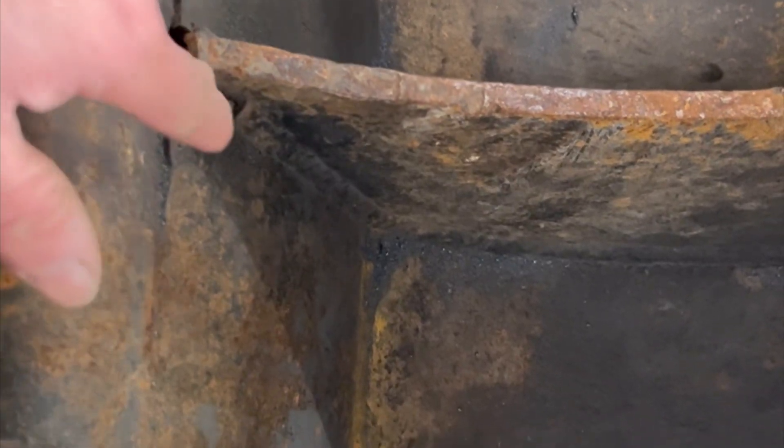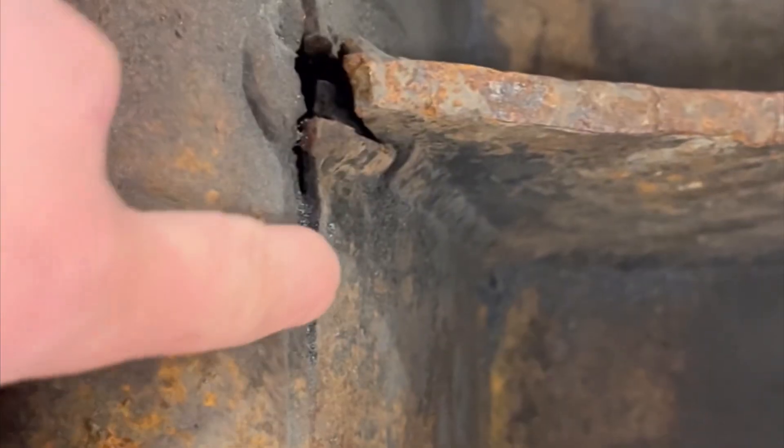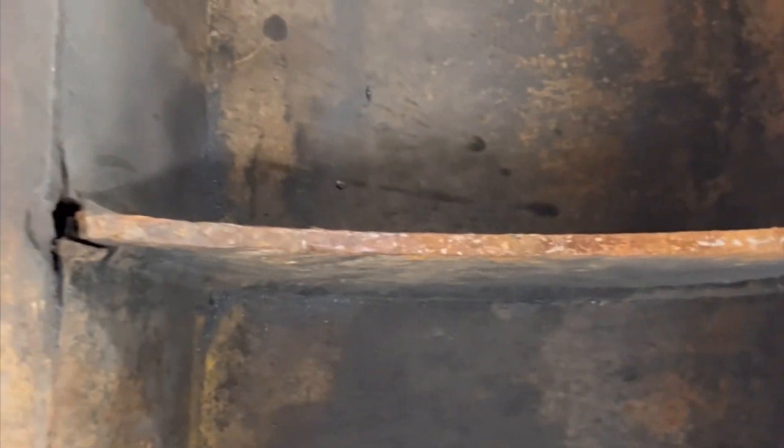With this bit, I think what I'm going to do is run the plasma cutter down there either side, put a cut down there, and I should be able to knock that bow flat. Then plasma cut them bits of cracks out, and then hopefully I should be able to winch from there back to there to pull that straight again.